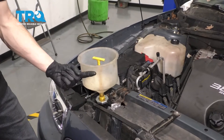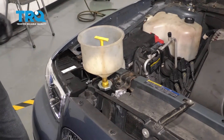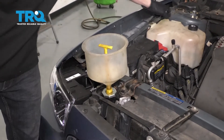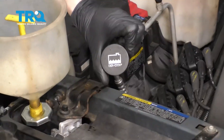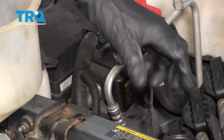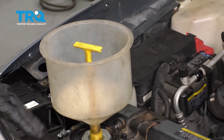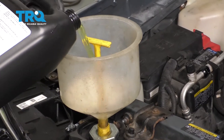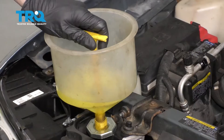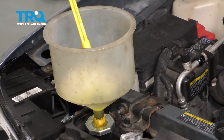Now it's time to fill our cooling system. It's a good idea to use a funnel if you don't have a specialty tool to fill the cooling system. When you fill this, you need to use the manufacturer's specified fluid — you don't want to use green coolant. If you look at the overflow tank, it tells you to use a specific type: Dex-Cool, which is kind of a pink-red. If you don't have access to that, you can also use a universal fluid, but make sure it's 50/50 mixed so it's not complete concentrate. Go ahead and pour the coolant in — this is the universal coolant, so it's yellow rather than green. Fill up the cooling system, and once it's full, start it up and burp out any air in the system.